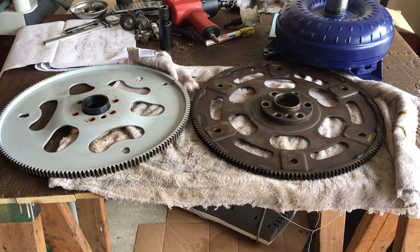I want to talk about the dilemma I had when I put a Turbo 400 behind my 4.8 LS build and found out I didn't have enough torque converter clearance to safely run the combo. Torque converter ballooning, crankshaft end play — what they call thrust — would have destroyed that Turbo 400 transmission.